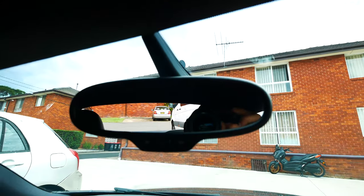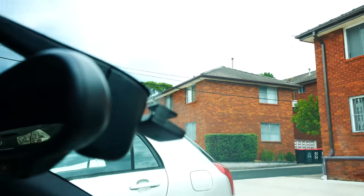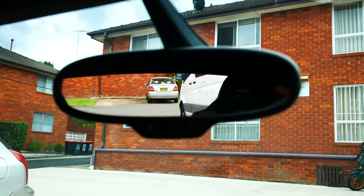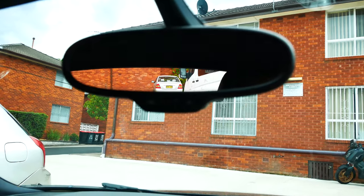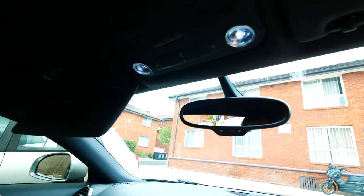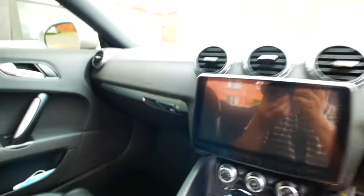This is the regular mirror as you'd all be familiar with. You can see from the side here — that's the normal mount and it's got the rain sensor underneath. What needs to be removed is the A-pillar and that light and your center light, so that you're able to run the new two CAN bus wires up and around and down to the CAN gateway, which is going to be here on a right-hand drive vehicle.